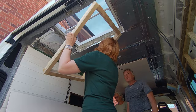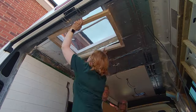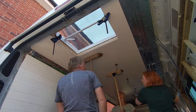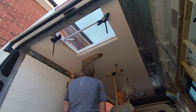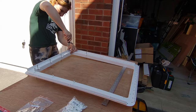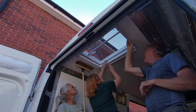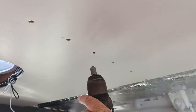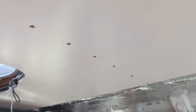The piece of ply at the back was a bit trickier because we had to work around the skylight, which requires the frame to be sandwiched between the skylight and the ceiling — so we hadn't put this in earlier like we had with the Max fan. Even though the skylight was from the same company, Max Air, it was a different technique to install. The way the skylight is fitted it squeezes the different layers together, so we partly installed it originally and then had to unscrew the bottom part, put the frame and the ceiling up, and then screw it back down again. It was just a bit fiddly but we took our time, made sure we got it all lined up perfectly, and then dad went around taking all the screws out one by one, doing a countersink hole, and putting the screw back in.